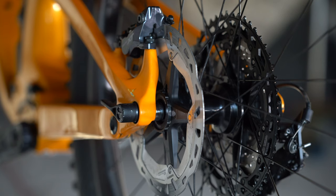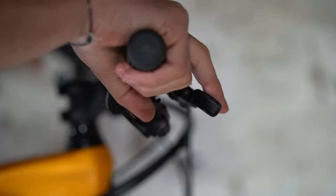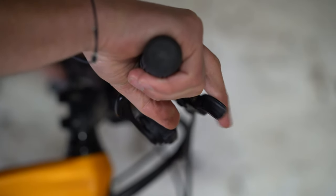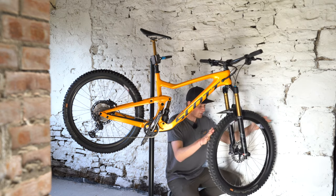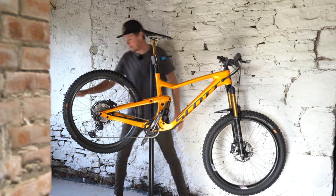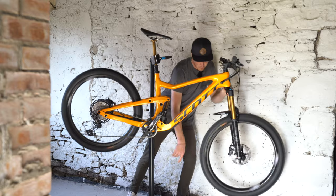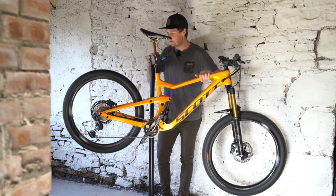We've checked over the wheels and the tires and they're looking good. Let's move on to the brakes. Come up to the bars, grab those brake levers, pull them in a couple of times, see how they're feeling — they're feeling pretty awesome. If they're feeling spongy, then perhaps they might need a bleed. At the same time, you can also come down and check your disc rotors. Have a look at the pads, make sure they've got plenty of life left in them, both front and rear. Give them a spin — they should be running freely with no rubbing, because if they're rubbing they won't be as efficient as they should be.